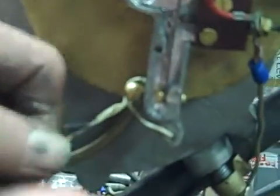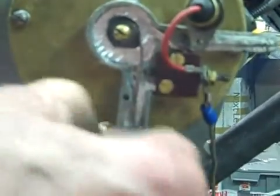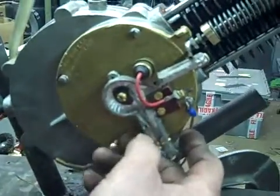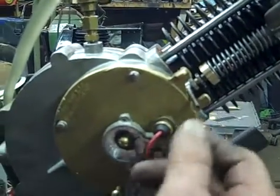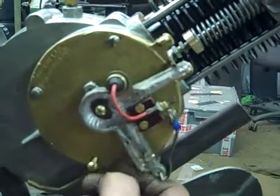So this is a part that I would say was acting like a decompression part, this whole timer is, but I really don't like them this way. I prefer maybe the model that has the magneto style that's usually mounted up here. Then this configuration they don't use as far as the lift of the exhaust valve. They have another bracket that mounts up here, and you have a little bit better control and the least amount of breakage when it comes to these aluminum castings. They're not very good, but they do serve the purpose. So you can see how that valve lifts up when that's pulled.